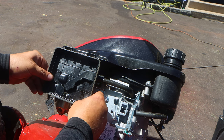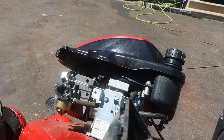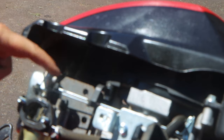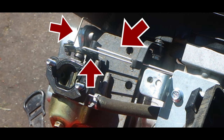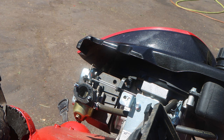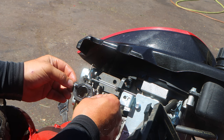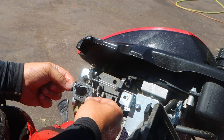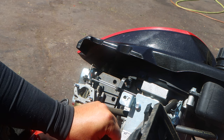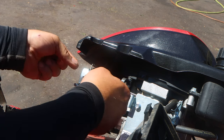So right from here, we're going to expose this, tilt this to the side, and look at all these extra levers — one here, one here, one here, and one here. All three. Don't freak out. Alright, so there's going to be this hard metal gasket. Sometimes these are stuck and frozen, so what you do is you take a flat-tip screwdriver, a very small thin one, and you work your way around. And then it comes right off. I like to flip it on its side and put it over to the side, because now we know when we put it back together, we flip it back up.